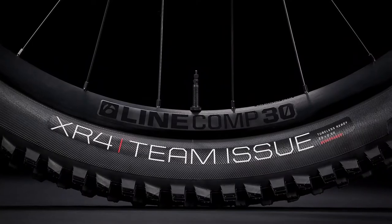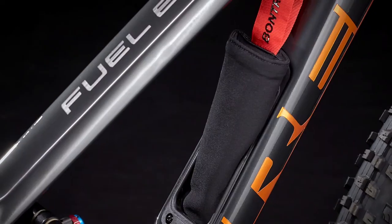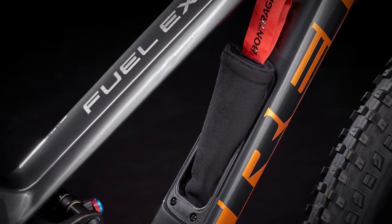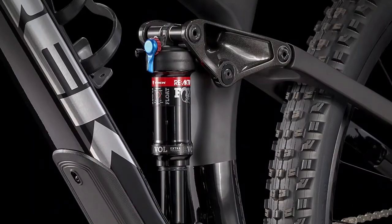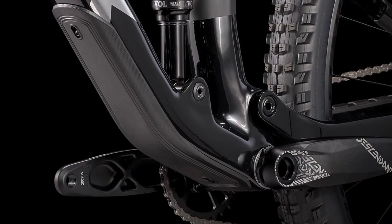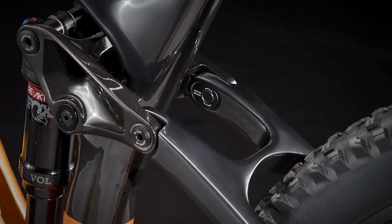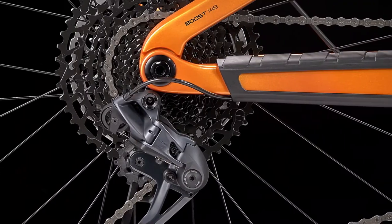The tires may be big and look chunky, but they're fast-rolling thanks to their tread that doesn't protrude very far from the carcass. This makes it smoother to pedal through tarmac and fire roads. Wider tires allow for slightly lower pressures, which is very helpful on more technical climbs. However, the rims are narrow, so they don't provide the right tire pressure to prevent you from slipping on greasier climbs.